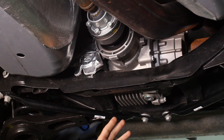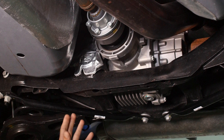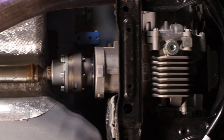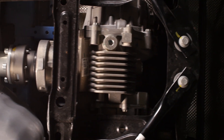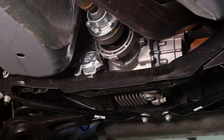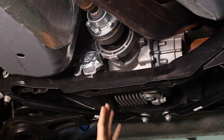Ford is using GKN Driveline's Twinster differential. This differential is currently only available in the Focus RS and also the Range Rover Evoque. It's a really cool system — we have a computer-controlled differential with two wet clutches and a series of valves. The computer for the diff is talking with the ECU and also the brake module to control power output to each of the rear wheels. So if we have a traction loss event on one wheel, the power can get shifted to the other one. Ford is claiming 70% of the power can get sent to the rear differential. What's really going on here is when there's a traction loss event in the front wheels, all of the power is constantly being sent back and the differential computer is choosing where that power is directed. Say you throw this car into a left-hand turn and we have all of our traction on our right-hand wheel — the computer is actually able to sense that and send the power out to the wheel with the most traction.